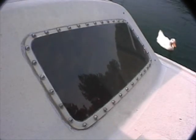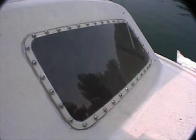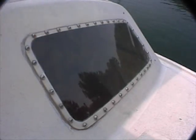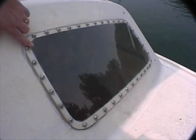We've had our adventures sealing those windows too. We originally used double-back sticky tape, but found that the foam in the tape was actually porous and allowed water to migrate through and drip on the inside. Removing that tape was a royal pain. We literally had to saw between the hull and the window with a thin saw blade to break the tape